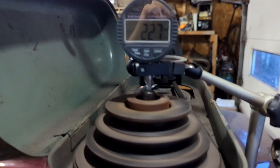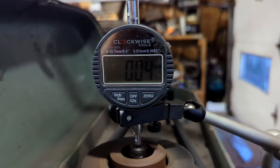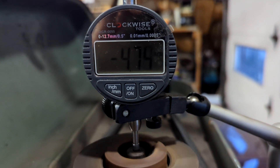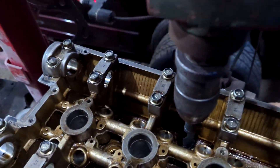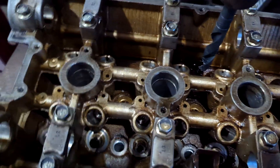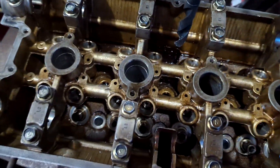Now that we're centered in the hole and all set up, zero it out and switch on the drill press. We're looking to go down five millimeters. Close enough — switch that off and loosen the table. This isn't a precision science, it just has to be close. You don't want to really overshoot the hole. I've got to go down a little bit more. This drill press is pretty old but it does the job way better than one of those cheap ones.